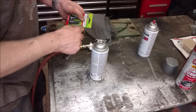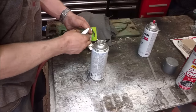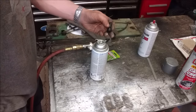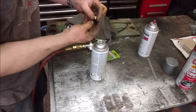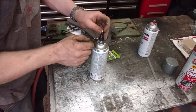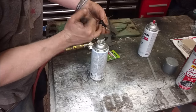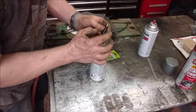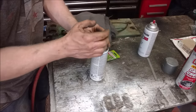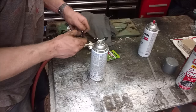There are two different ways you can do this. The first way is with a tire Schrader valve. These are the things sitting in your car tire, and what we can do is just put an air fill on the end of this - just a tire fill. This brass piece goes down to about that ridge and we're able to put this over and compress the rubber enough that it pushes the depressor down inside so everything is captured in there. Then we can add air and nothing sprays out in our face. That's actually my preferred method.